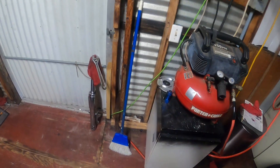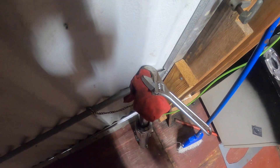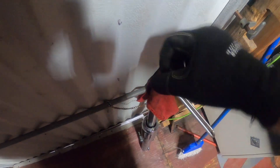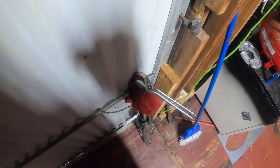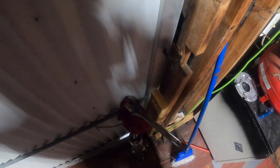I'm fixing to try to do this one. What I found: I put a rag over it and loosened the top nut while it was still in the forks — the triple trees. Now I've got a wrench and a rag over it. It works better to hold it in one place up here — don't try to turn that top bolt out, just hold it in place and then with your left hand unscrew it, keeping pressure. It'll pop a little bit, which startled me at first since I've never done one before.